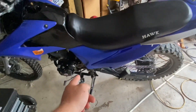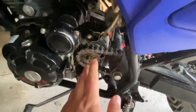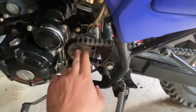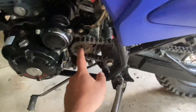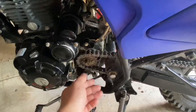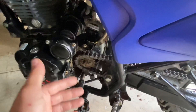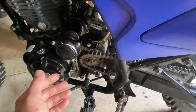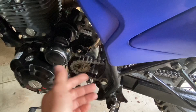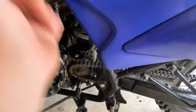I want to talk about the front sprocket. This is a 16 tooth front sprocket. Before, I would just switch between the 15 tooth and the 17 tooth. I would put the 17 tooth on for road riding if I was going to be road riding a lot. I ran the 15 tooth front sprocket on road quite a bit, just because every time I hit the pavement I'm also hitting the dirt — there's never a time where I go out and just ride the road. So the 15 tooth made sense to keep on there. However, it was a little bit too slow for the road, and honestly the 16 tooth is kind of a bit slow for the road as well, but you can at least cruise at 55 with the 16 tooth on the front.